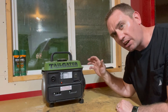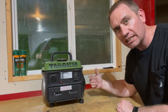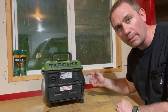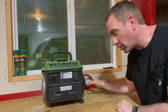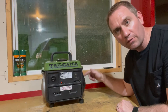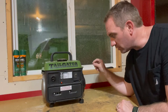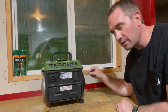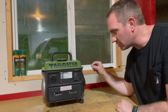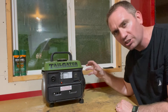The other thing you need to be careful with is stripping the hex head of your crank bolt. You need to make sure you're fully engaged with that socket and your drill before starting it — otherwise you can round that bolt over. The good news is you can always go back to a recoil start if you didn't damage your shroud. But also know there's always a risk of shearing that bolt off. Be careful with a drill and have a good feel for how much power you can put in before shearing it off.